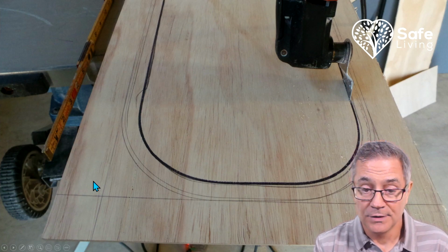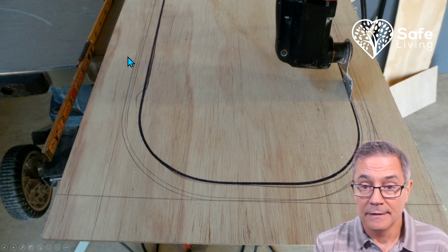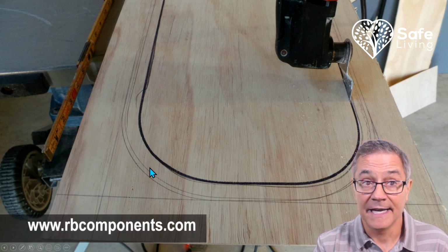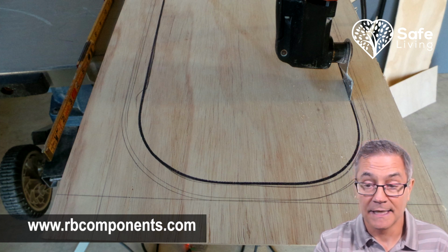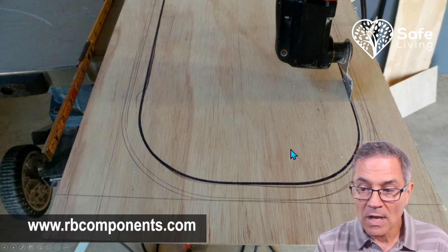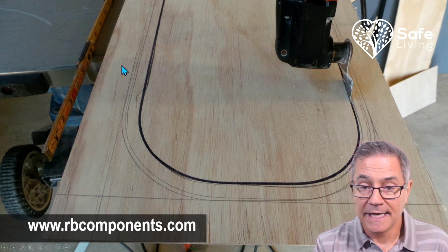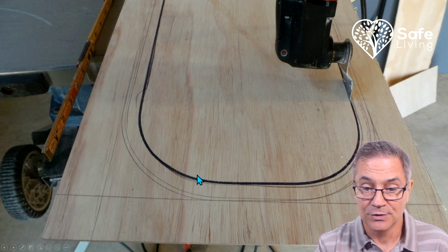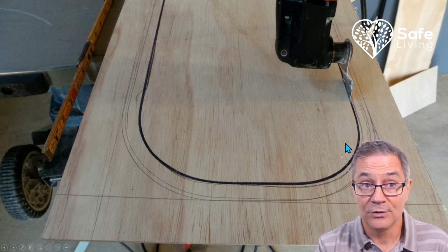One of the things that I wanted to do is create a finished trim piece. So we do need to have some piece of plywood against the van inside, because the trim ring is going to go against this wood piece and pull the window together to the van and create a sandwich. I decided to take a 1.5 inch by 1.5 inch wood frame around here, that I'd be able to secure my interior wall panels to, and still act as this wooden trim piece that needed to go into the window anyway.